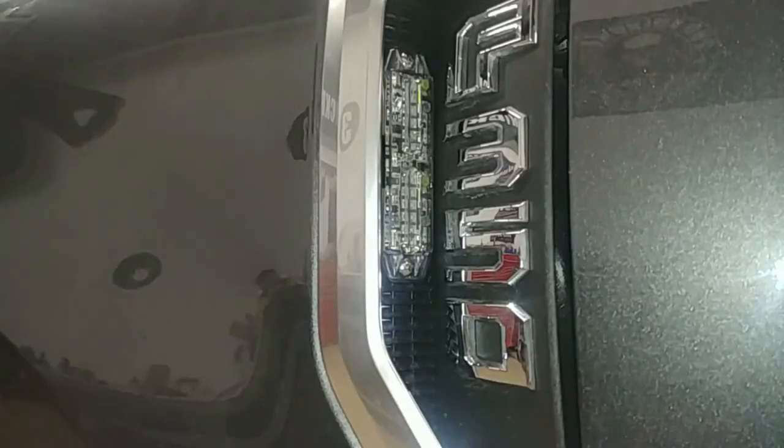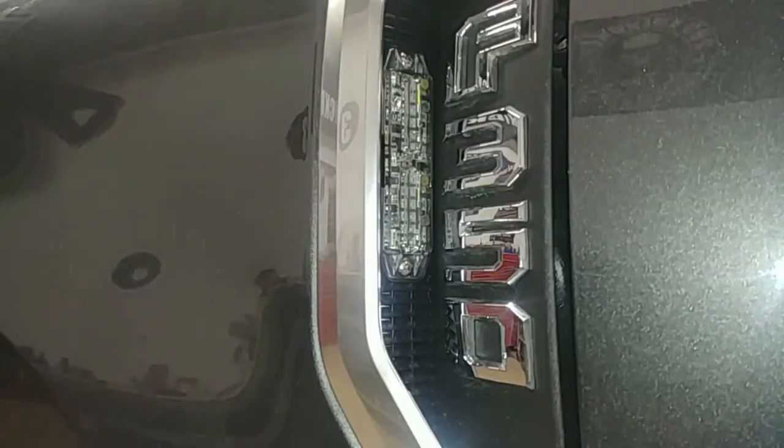Here's that same light mounted in the badge — our Thin-X light — and that's a fairly easy mount. You do have to drill a little hole for the wire and use a little piece of plastic or a speed clip behind it for the screw to grab into. If you're very careful, sometimes you can get the screw to bite into the mesh of that grille, but I like to put something behind there — a little piece of plastic or speed clip — to anchor it further. And I know the next question: where do the wires go? Let me show you.